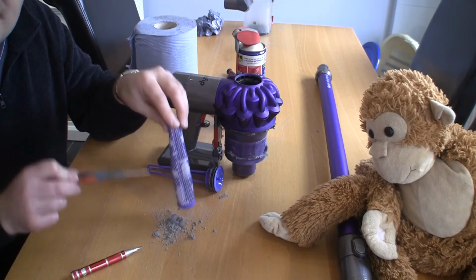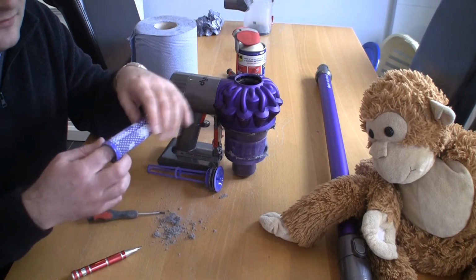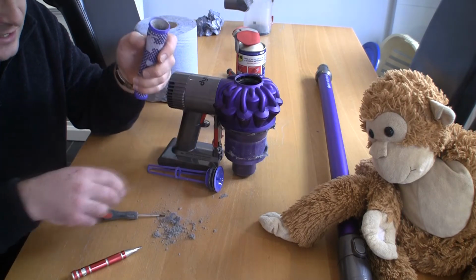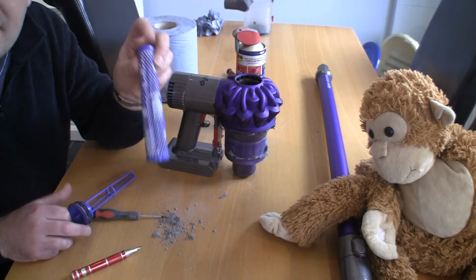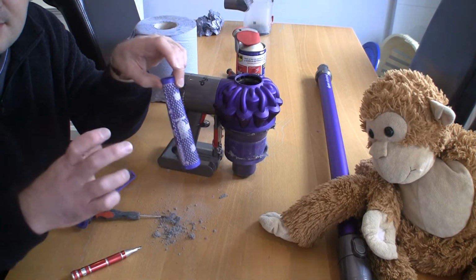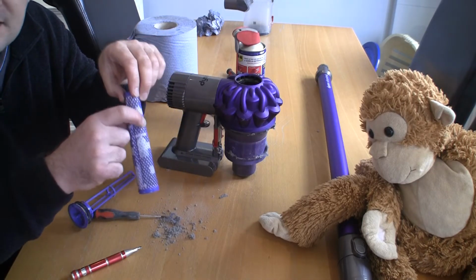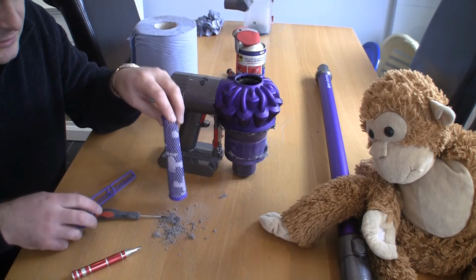So I always recommend replacing this filter. As I've said, there's a link in the description of the video for a new one. But at the very least, I would be taking this off here and giving it a good tap out, and I would be rinsing this out and trying to get as much out as you can. As I said, if you don't have an air compressor, you can get a small can of air duster. It's basically compressed air in a can, and you can blow it out. But for the price of that, you could buy a new filter.